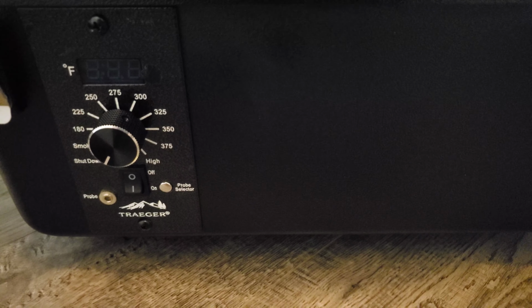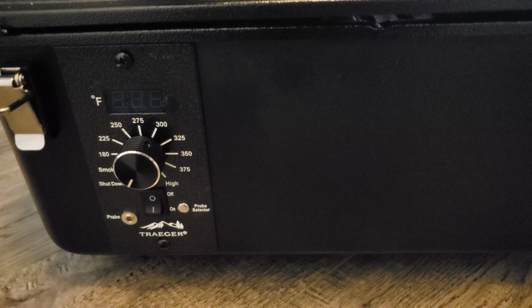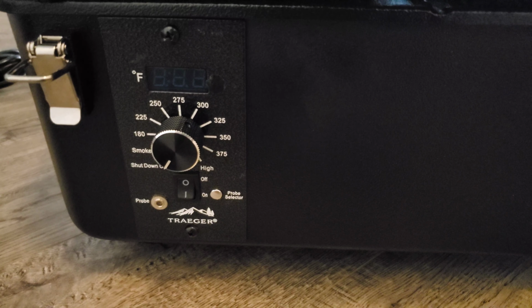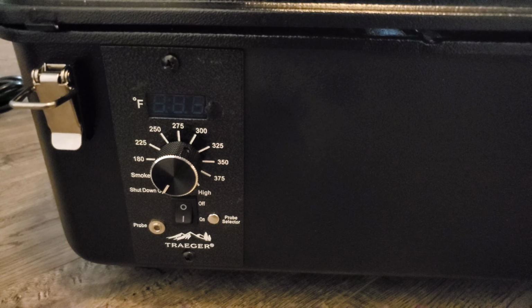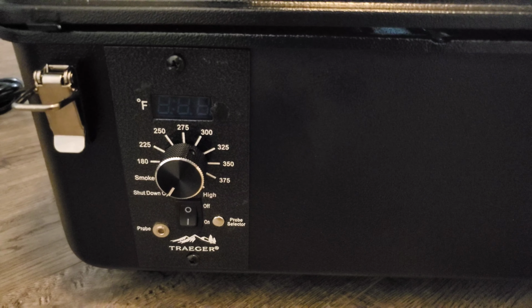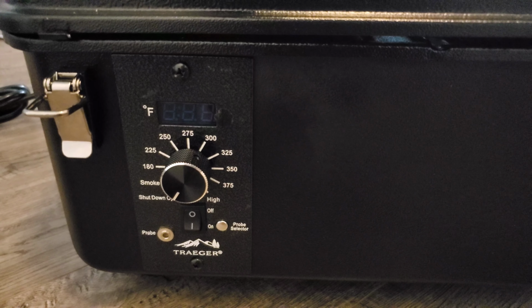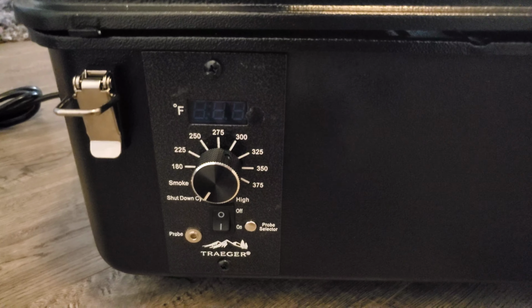When I would have the heat go up to like 300 degrees, I would hear the auger keep spinning and spinning and spinning, and the temperature would go higher and higher. And my setting was at P2. So P stands for pause, and it was 2, so that was like every 15 seconds it would pause. I ended up switching it to 4 and later to 5, and that held my smoke setting right around 200 plus degrees.